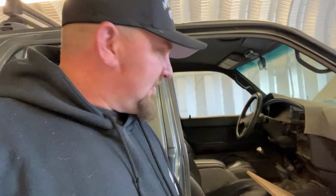It is a manual transmission, so it's got an R150F transmission in here, which bolts up to a chain drive transfer case. Doing away with that, we've got to get rid of it so we can do the dual transfer case. But with that being said, to go from an R150F to a 4-cylinder transfer case, you have to buy a $500 adapter that adapts that transmission to a gear-driven transfer case. And then you have to buy the adapter to go dual transfer case.